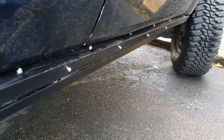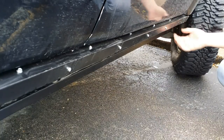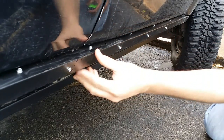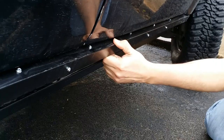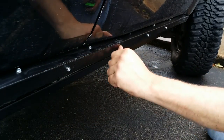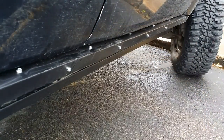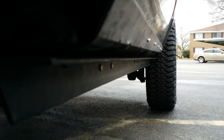The reason is there's nothing back here, because that bubble starts literally right here, and the bubble ends somewhere right there. That's why all the bolts are concentrated in the middle, and I put a couple along the top and a couple along the bottom. That way, if I did hit something, it wasn't gonna bend it or pry it off. I just wanted it on there as tight as possible. I was gonna go back with some paint and probably paint the heads of the self-tapping screws black. And just so y'all know, everything I did on the passenger side is exactly the same on the driver's side.